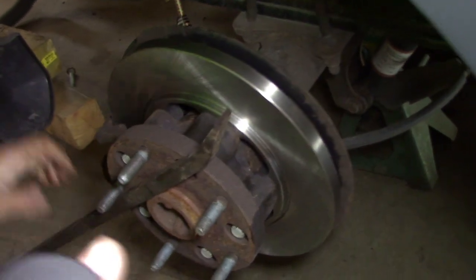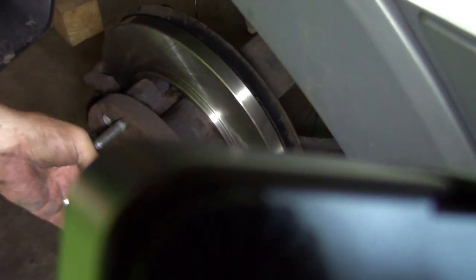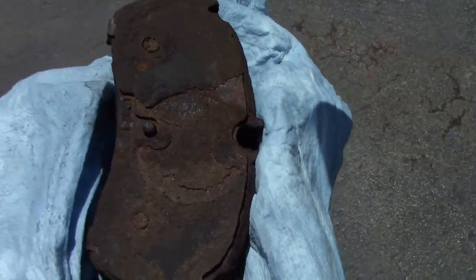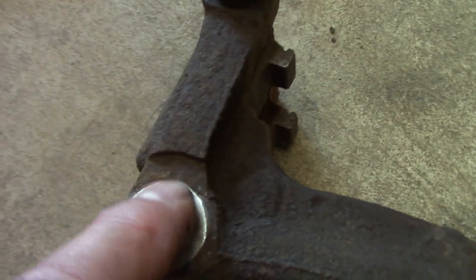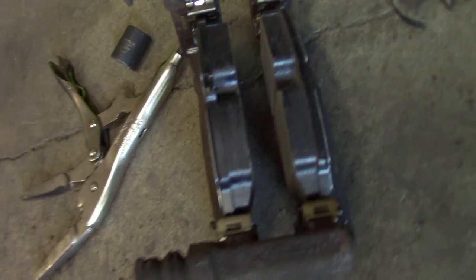Probably from salt and rust. Here they are with the new discs back on. You should replace the bolts every time you change the brakes because you torque them down and then add a quarter turn — they're stretch bolts. The problem with a lot of these early Transits — this is a 2015 — is that the brake pad wear is at an angle, not straight. The issue is that Ford installed the caliper bracket (backing plate) left-for-right and right-for-left, so they need to be swapped. There's a Technical Service Bulletin (TSB) about this — I'll put a link in the description.